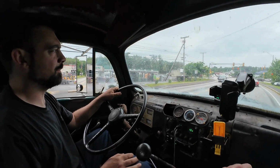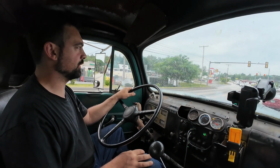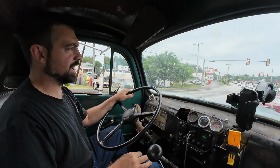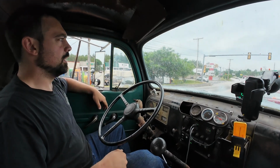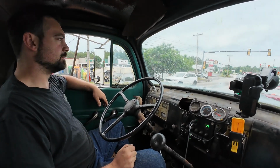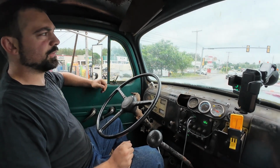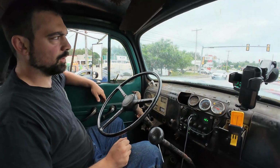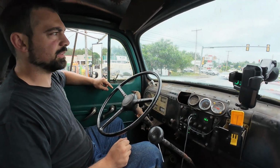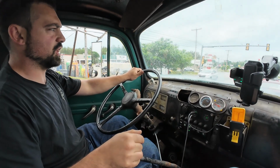You know, this is set up to government regulations right now where they try to keep you from blowing smoke. So I have a boost reference line that I have to disconnect so it always throws full fuel. A couple little things like that. Now, I forget, are these the ones that are turbo and supercharged? Yeah, there's a blower on the side of the motor, which doesn't really make boost. It just creates a little air movement because these engines without a blower just will not run.